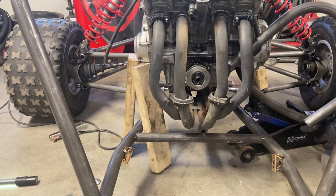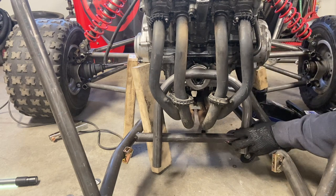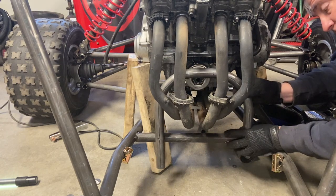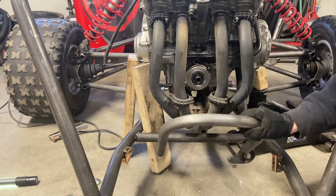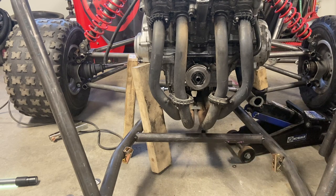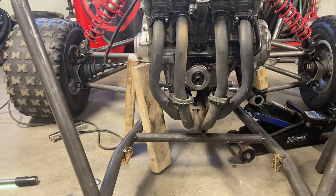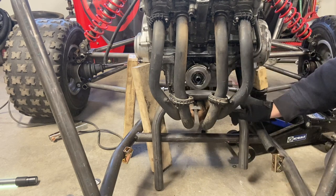Now we need to figure out the front mount — here are our attachment places. This is where C41 comes into play. If you're using the Polaris 500cc engine you probably won't need this because you can mount that super low. You need to take measurements and figure out whether this is going to go above or below the oil filter. I made this so you make 90-degree cuts and then you can rotate it around the forward crossmember, make your tabs, and it'll be solid, square, and easier.